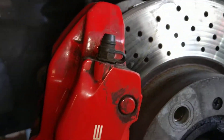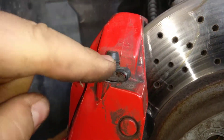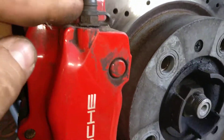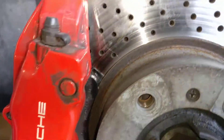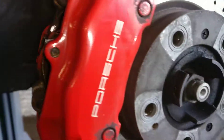Another tip which I learned from the mechanic: when you bleed those brakes, you have to bleed them both sides — one here and one here. A lot of people make the mistake of only doing one side, so on this particular car you have to do both sides. That's it, and that's all to it, really, on the pads.